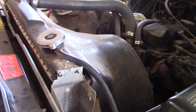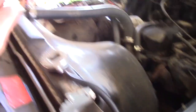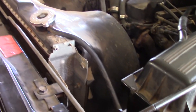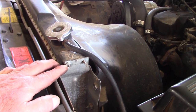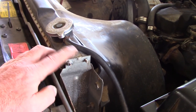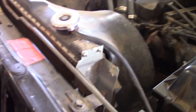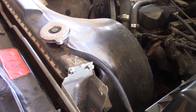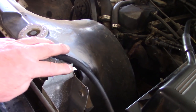I'm going to end up pulling the radiator out to replace all of the missing nuts or anything that might be iffy, because in my opinion you can't have a vehicle like this — that's super bouncy and jumping around — with the radiator just rattling around doing whatever it wants. You'll end up with a leak. Also, if you run into this problem yourself, make sure you do not over-tighten these because it's only going into plastic at the top and lower tank. I'm going to drain the radiator and pull this out.